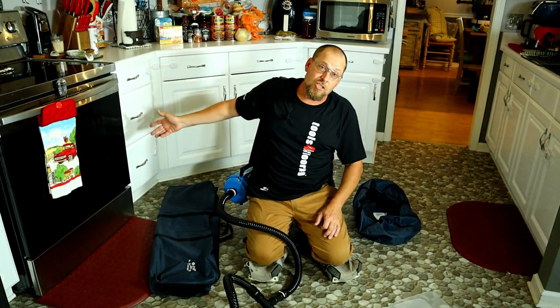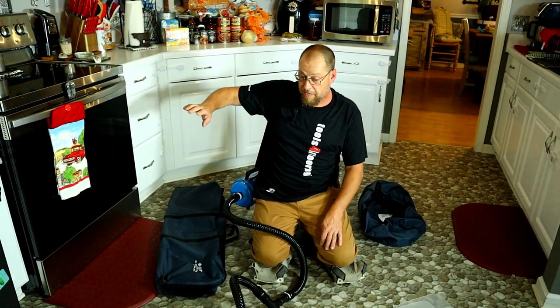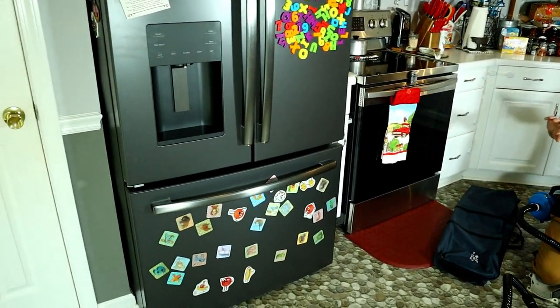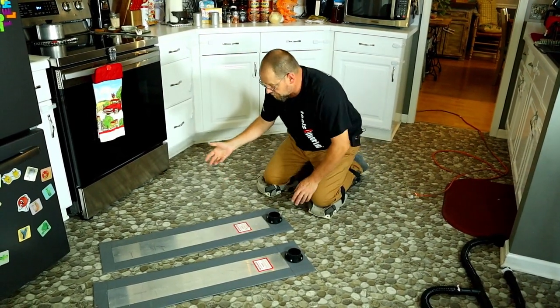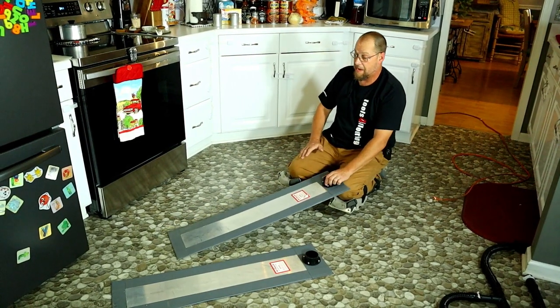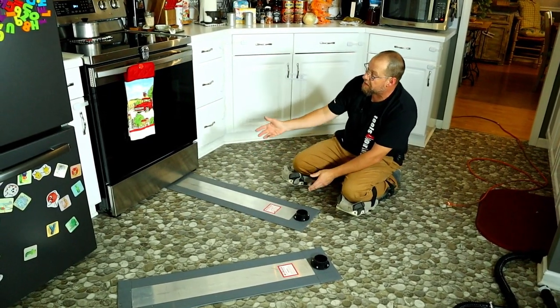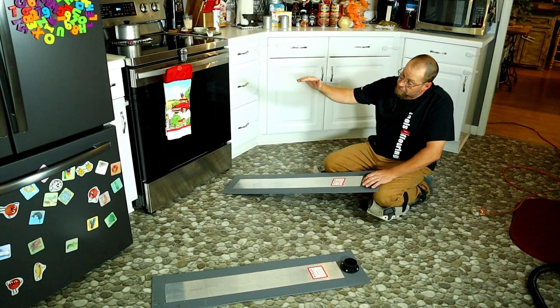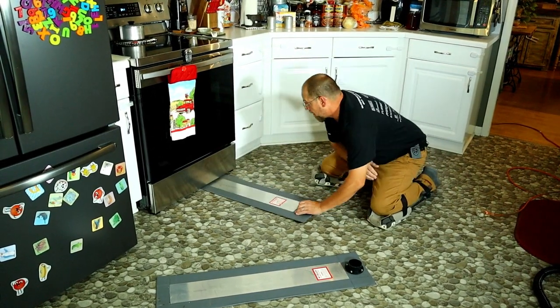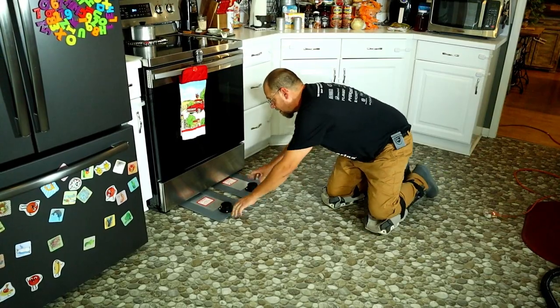Let's go ahead and hook this up underneath my stove and show you just how easy it slides in and out. Then we're going to move that big monstrous refrigerator — this is my own personal home so it's not an empty refrigerator. I moved my rug out from underneath the stove. You simply take these sleds — you don't have to go under the feet if you center it. These things expand three inches high, so as long as you've got three inches of clearance from the bottom of your stove past your feet, you're just fine. Slide that all the way back as far as it'll go.